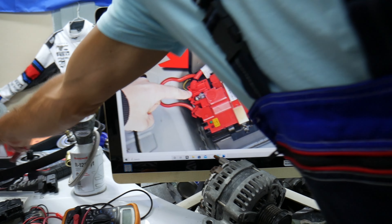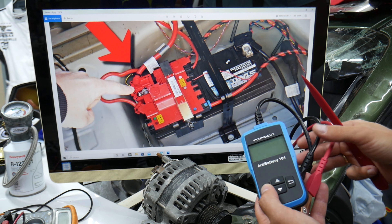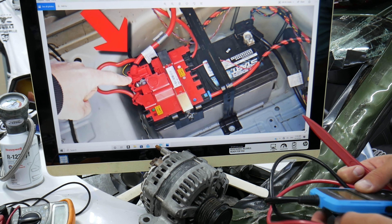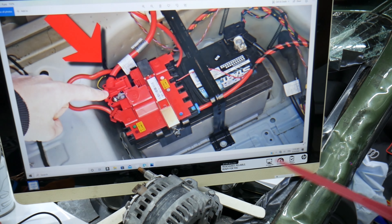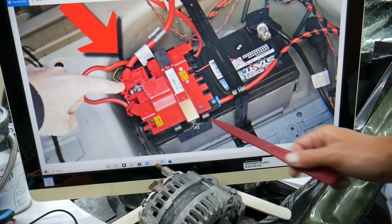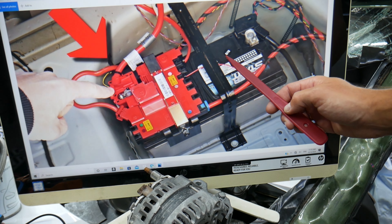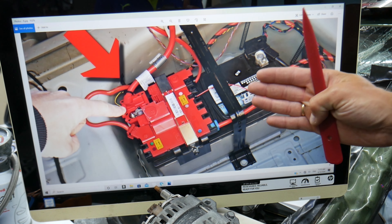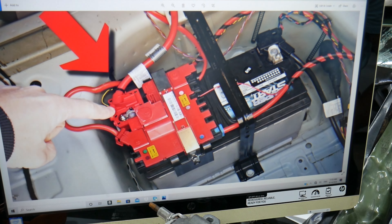The first thing to do is get a battery tester and test your battery. Modern vehicles have 40 to 50 different modules and computers that can cause quite a bit of drain on the battery. If you have a weak battery, they can start self-discharging. If the battery is old — like this one from 2019 — that can easily happen. We just replaced the battery out of a BMW X4 from 2014 that lasted 10 years, and it was in a warm climate.